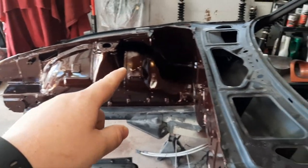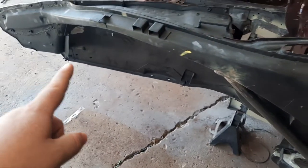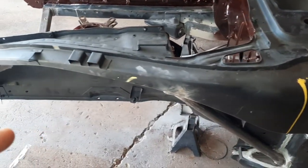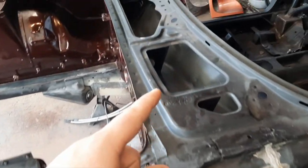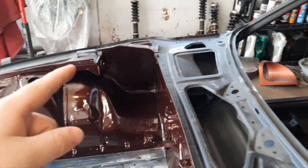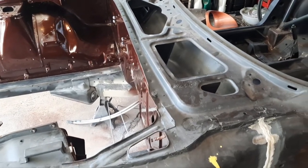From here we got to work on this area right here. This is the wiper cowl and it wasn't painted with the engine bay, but it's gonna be the same kind of coating as what's going on here. The coating I'm gonna be using has a pretty wide spray pattern, so with these tight areas I'm gonna try and use their canned product. So that means I have to sand it, prep it, and then I can spray it.